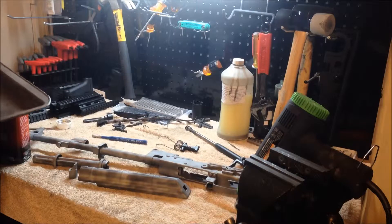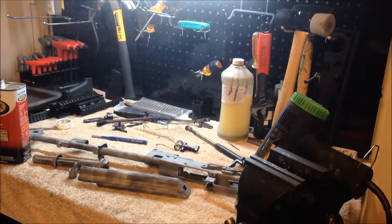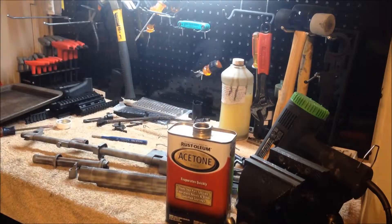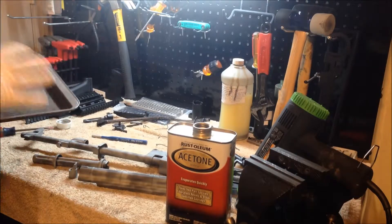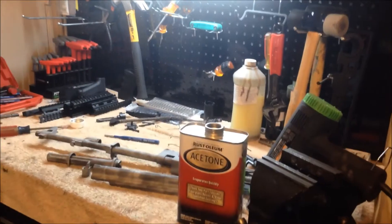That way when you're baking it - you can actually see where some parts came off. It was from either leftover residue of the moly resin or leftover from using the aluminum oxide. Now that we got that good and clean and we know it's not going to pass off any extra particles, we're going to set that to the side.